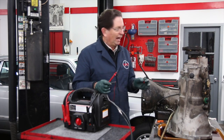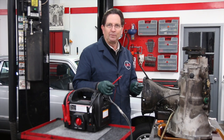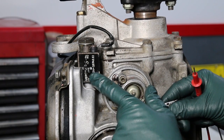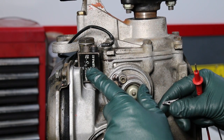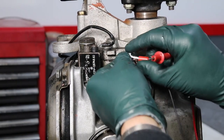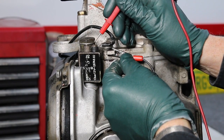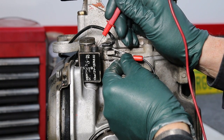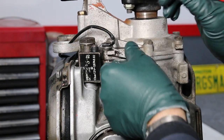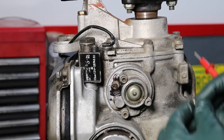Here's an example — watch as I put the test to this solenoid kickdown valve. This is an electric solenoid valve. When I apply 12 volt power to it, it's going to move internally and I should be able to hear it click. If there's no clicking sound, then it has failed. So I'll apply the black clip lead to ground and then take the red or positive probe and just touch it right to the inlet wire here. Can you hear that clicking? Nice, good solenoid clicking sound. That confirms that this valve is working properly and I can go on to my next test.